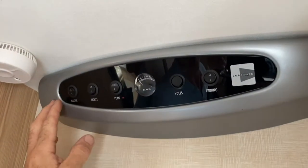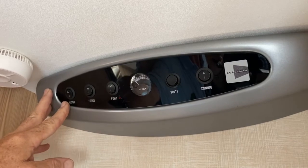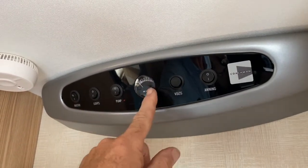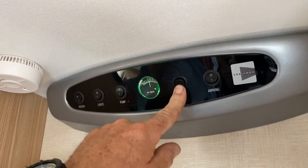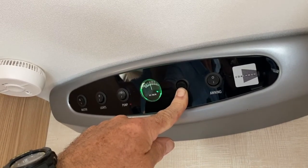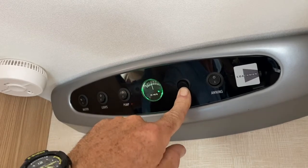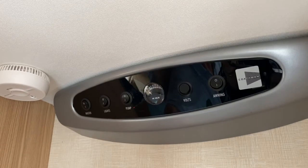The master switch is this left hand switch here as I'm looking at it. That has to be in the on position, and if we just want to see if we've got good 12 volts, press the voltmeter and we'll see that the voltmeter starts to move and we're just literally on 12 volts, which is what I'd expect a good battery to be. If I've got a main supply in I would expect that to read probably 13 volts or possibly slightly higher, but that's given us good voltage at the moment.